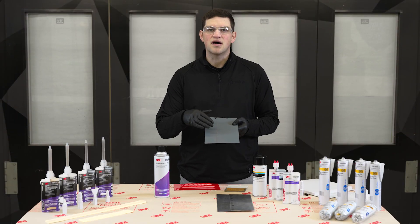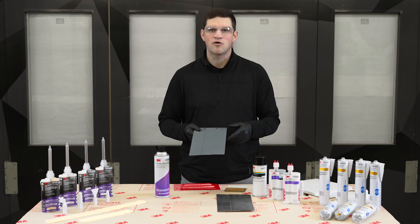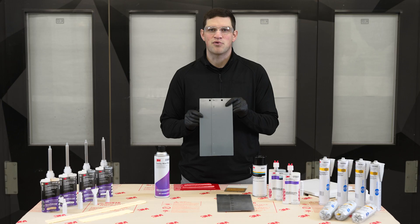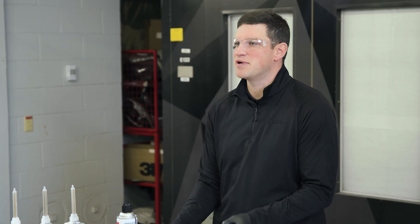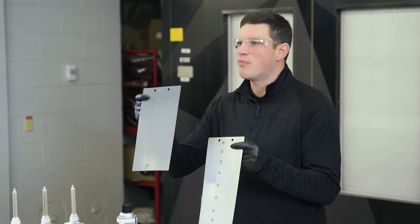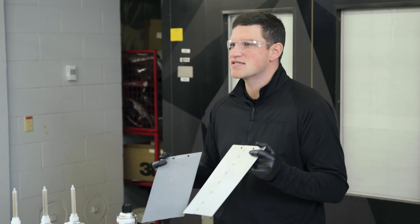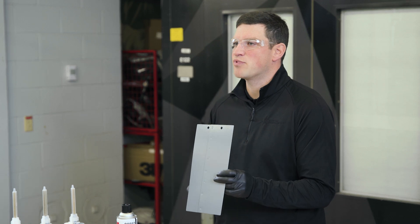Most of what we're going to talk about today is our exterior corrosion protection. One of the key OEM differentiators in corrosion protection today is the use of a 2K epoxy primer. There's a big conversation going on today about whether to use bare metal or epoxy primer. Many OEMs — those like Tesla, Rivian, Stellantis, Lucid, Honda Acura — are calling out the use of a 2K epoxy primer today.